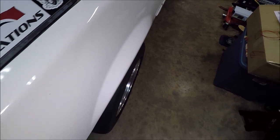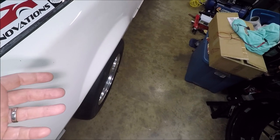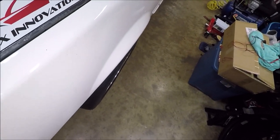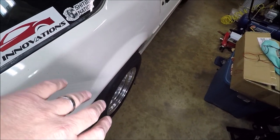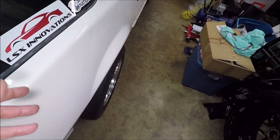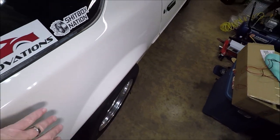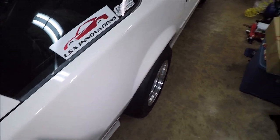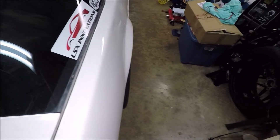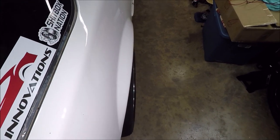The main reason I'm making this short video is because I see this question asked all the time on the third-gen pages on Facebook and on ThirdGen.org — people are always asking what backspacing they should run with a 15-by-10 on a third-gen Camaro. Well, this is it. Some people will tell you to run a 6.5 backspace, but if you do that it pushes it in and you have to do a whole lot of cutting inside. If I hold the camera right down the body line, you can see it's not poking out at all — that's a 15-by-10 with 5.5-inch backspacing.